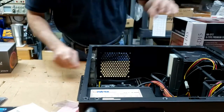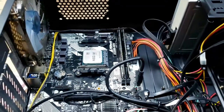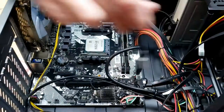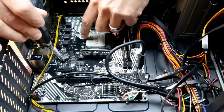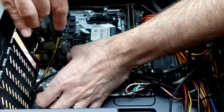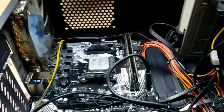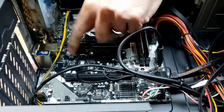At the base of the battery there's a little tab — you carefully pop it to the side and it releases the battery. The reason I'm doing this is because all you need to do is pop a big graphics card in here and a big CPU cooler, and after a while you reboot and the time isn't right or resets. That's caused by this battery. So I'm just going to push this little lever, pop the battery out, and put a new one in. It's a CR2032 — just push it in, it clicks, and now you won't have to mess with that.